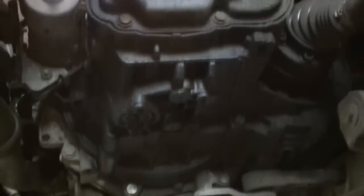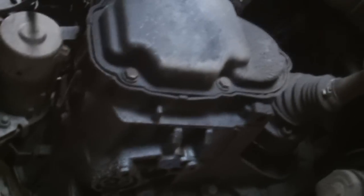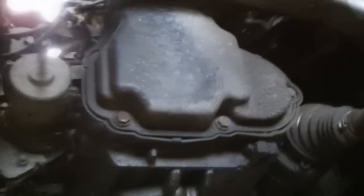In this short video I've got a VW Passat and we're going to remove the gearbox and put a new clutch kit and flywheel. It's just the same operation as the other gearbox — out the drive shafts, off the starter, drop the box, disconnect a few cables, pipes and wires, and we'll drop the box out. And then we'll remove the clutch and flywheel.